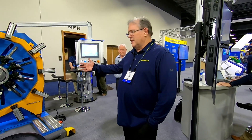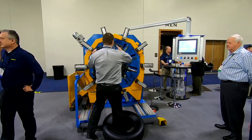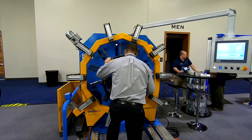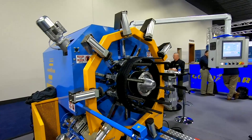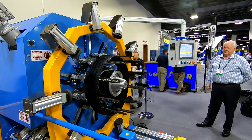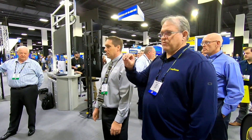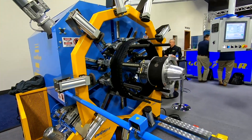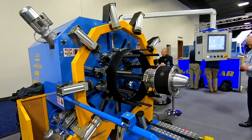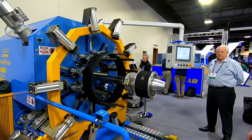We'll start off with loading the machine with the tread. It's a solid ring that's cured all in one mold — it has no splice to it. Once the tread is mounted on the machine, we will stretch the tread out and then load the tire. It stretches it just enough tension so that we can hold it centered, and some stamper arms come out to make it perfectly centered around the circle there.